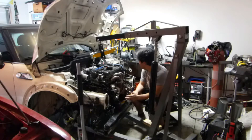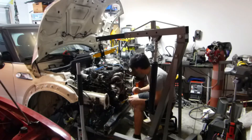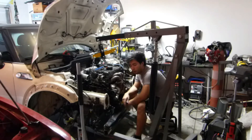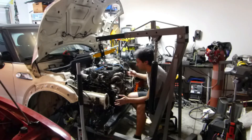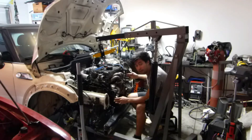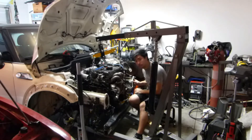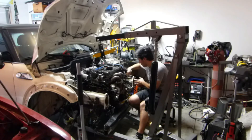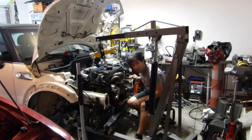To fix this, we have to cut the frame rail to gain an extra inch of clearance. We're about two inches off center, so we need to split that difference and bring it in one more inch. The frame rail is 16 or 14 gauge pressed and spot-welded steel. We'll cut across it to open up the inside, then weld in eighth-inch plate steel along the seam to close it up and reinforce the structure, regaining as much strength as possible.